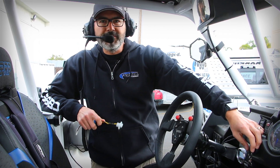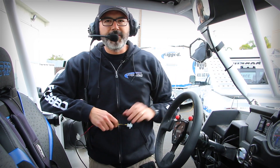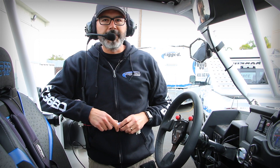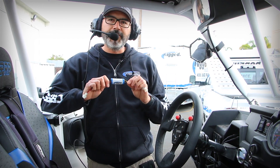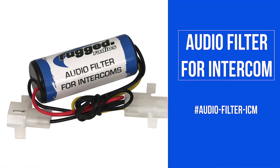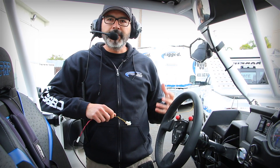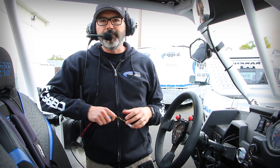As soon as the electrical on the car starts turning on, that fuel pump starts turning and it just sends a nasty whine right through the intercom. Now what we can do to cure or mask that is install one of our audio filters. The audio filter will filter out a lot of that electrical noise and isolate the ground so that you're not looping all that ground through your intercom system and creating a bunch of noise.